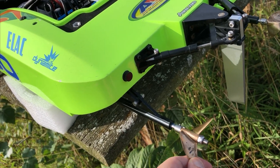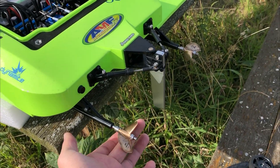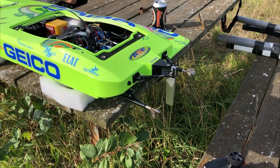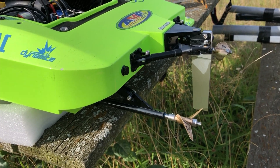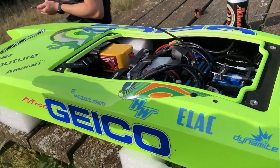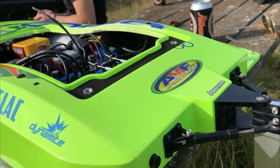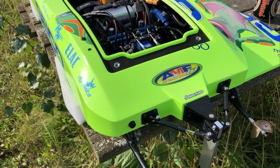In general, the bigger the prop, the more lift on the back. When a prop is described as a high-lift prop, the lift you're referring to is the lift created by the prop — meaning the transom coming out of the water. That might be a bit confusing: more lift from the prop means less lift in the front. Ass up, front down — more or less, that's how it works. That's about it guys, now get out and make some fast passes!